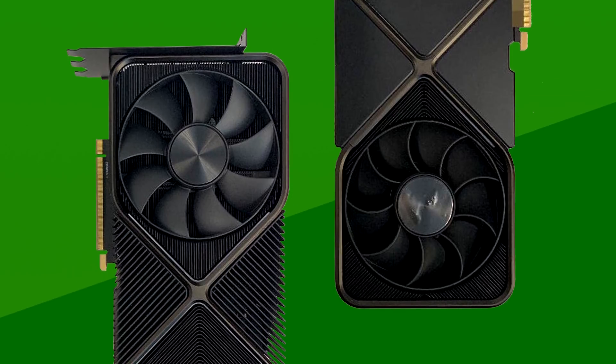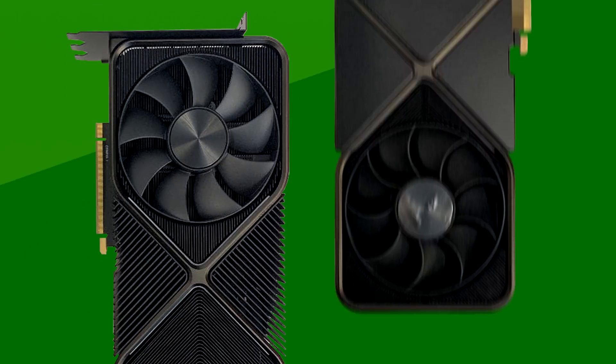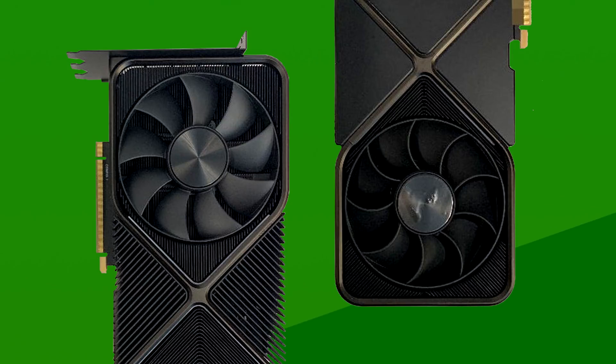As for the length of the card, it looks to be about 15 to 16% longer than the 2080, making it a little over 300 millimeters long, or 12 inches — that's bigger than this already super chunky RTX 2080 Super that's going in my next computer. Stay tuned for a build video. Just like the RTX 3080 design, the two fans look like they have different designs: the front one pushes air on the die area and PCB and rotates counterclockwise, while the back one pushes air through the fin stack and rotates clockwise. Another thing that is different from the RTX 3080 Founders Edition is the fin density, or at least the number of fins, since this card is considerably larger.